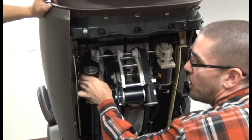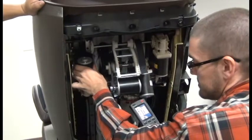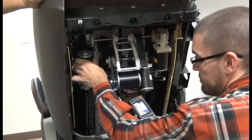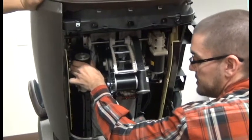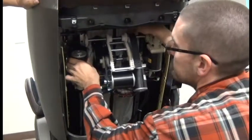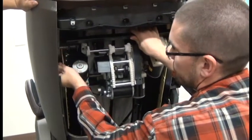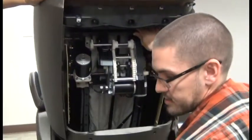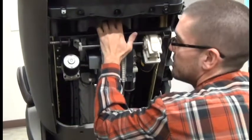I have the speed set to 20 and I'm using the minus button instead of the plus button. The plus button is speed 50; the minus button is whatever speed you set — I have it set to 20. This allows us to control the mechanism coming out. You've got a wheel with a washer and a spring: it goes spring, steel washer, wheel.